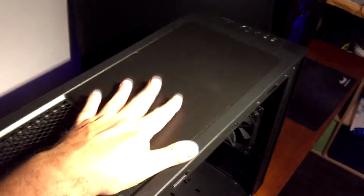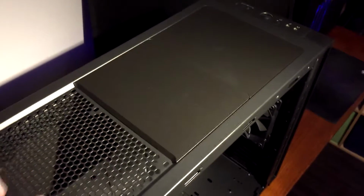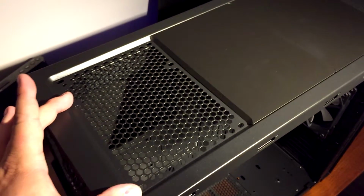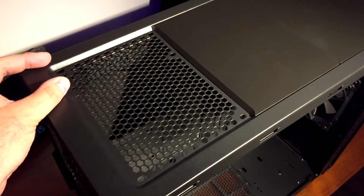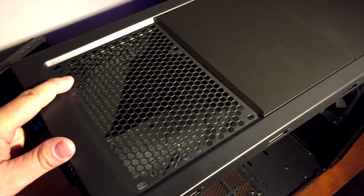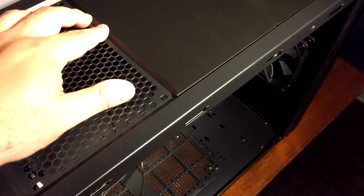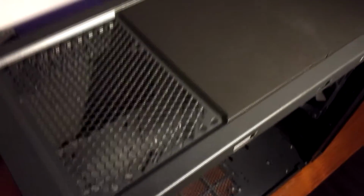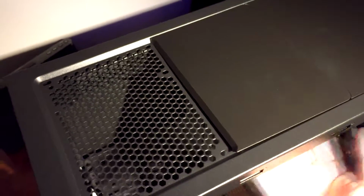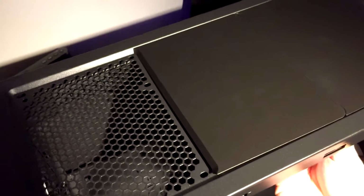This might not be representative of your experience because I'm big and clumsy. And if you look, you'll see that at least for 120mm rads, it's offset over to the side, away from your motherboard, which is awesome. It gives you much more room to work. And if you go to a 140 or to a 280 or a 420 rad or fans, then you'll lose the offset.